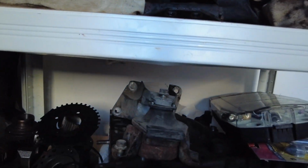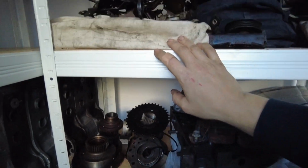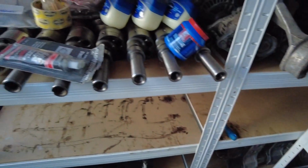I still have these irons, which are probably the best candidates, but they need re-nitriding. So I'm gonna make a couple of phone calls and see if that's worth doing right now or for another engine, because I have two rebuild kits, so that would equate to two engines basically. And I do want to take a stab at doing a hybrid Genesis at some point, so those might be better suited for that. So for now I'm trying to get this black RX-8 up and running.